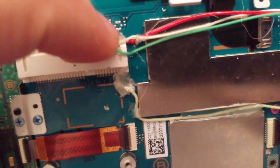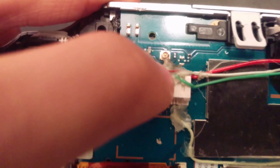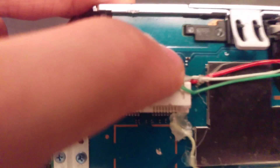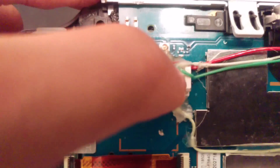For anyone interested in doing this, the steps would obviously be to solder those wires to those pins. How this works is: pin 0 starts from the very first pin, then it goes to pin 1 on this side. On this side, the second and third pins are the USB data lines — the second one is USB minus and the third one is USB positive.